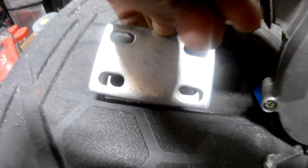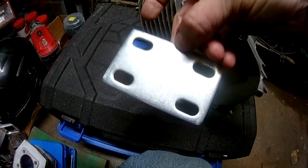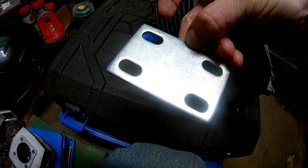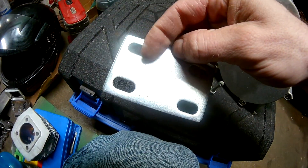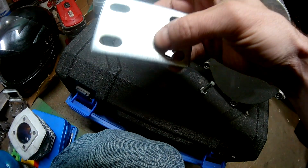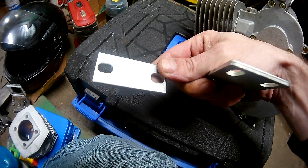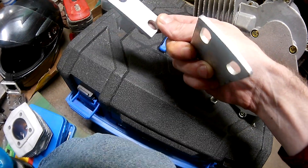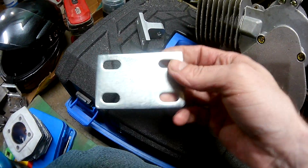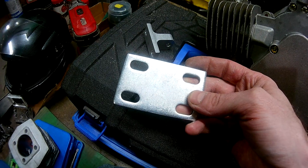You take this and you can mount this plate to your motor mount, and you can mount your motor to your plate. That's the whole thing, that's the key. You still have to use the plate, but that's okay - that's why they made these plates the way they made them. That's why these new plates are made the way they're made, just in case you have this issue. They're not going to change these mounts for the simple fact that there's too many old engines out there running around still, and I don't blame them - they've made enough change in the plate for the motor mounts.